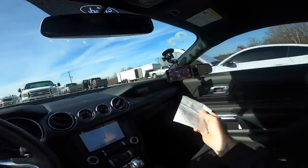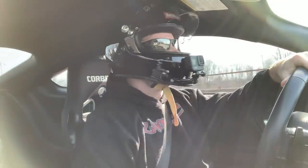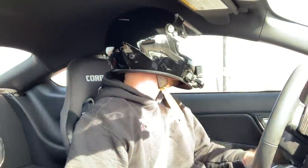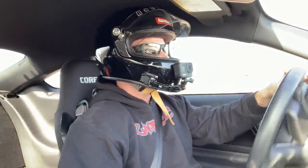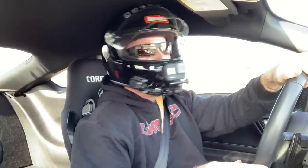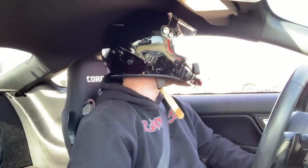We were in the left lane — 6.6, and that's a 1.5 sixty-foot. So we need to improve. I'm gonna run it back. We had a little bit of wheel spin there. We're gonna play around with the tire pressure a little bit and see what she does. But overall, not too bad for the first hit on wastegate. We're making about 650 horsepower in that ballpark — she spun a little bit.